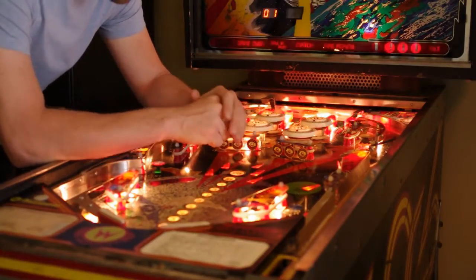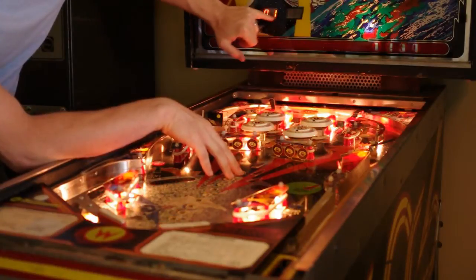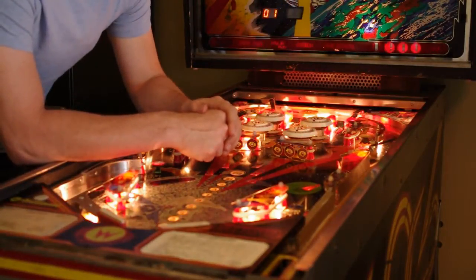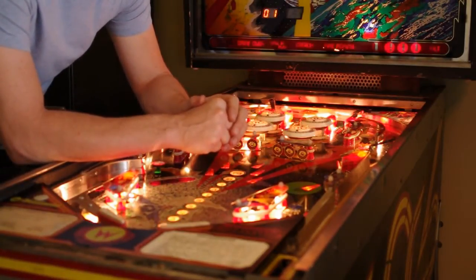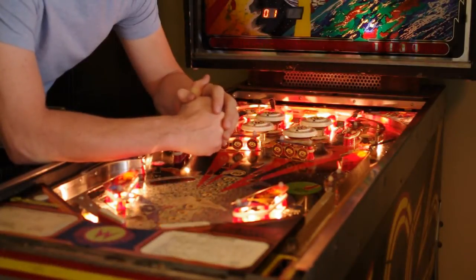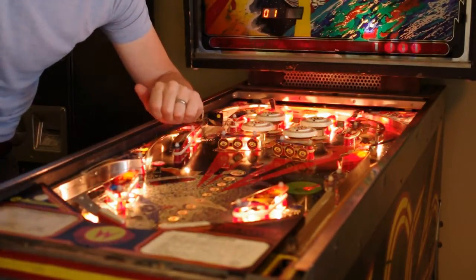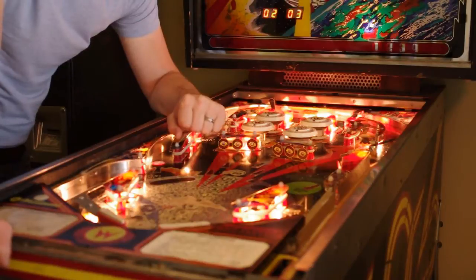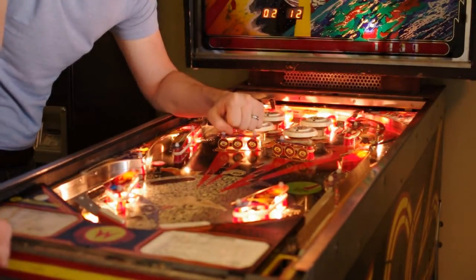The solenoid test sequence — I'm going to wait just a minute to put that on because it is so loud you won't be able to hear anything. On your display you'll see it go to 02, which shows the solenoid display, and then you'll see a number cycling from 1 to 24. When any number is on, it'll fire that particular solenoid once. Because this is a System 6 machine, the solenoid circuit is used for sounds as well. So on a System 4 and System 6, partway through you're going to hear some sounds also getting played. As you can hear, when it gets to the spot where there is a solenoid it fires it off once. And there are your sounds from numbers 9 to 16.